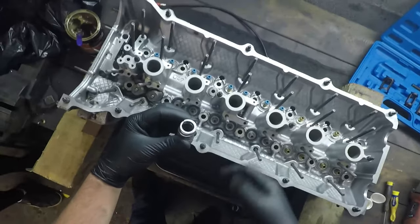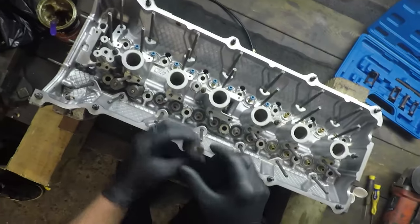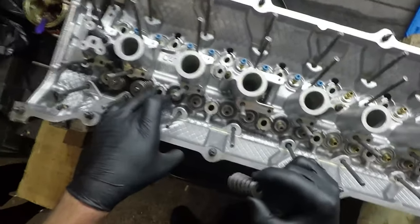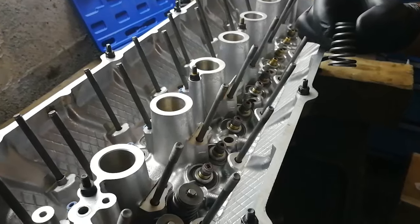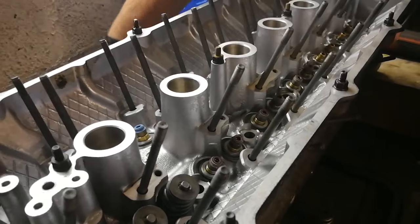The cone sits upwards with the little collar part — the washer, I can't remember the proper term for it right now — sitting in there, and this is going to go down over where the valve and the stem seal is. The stem seal is already in place as you can see, and below that we also have the valve spring seat.